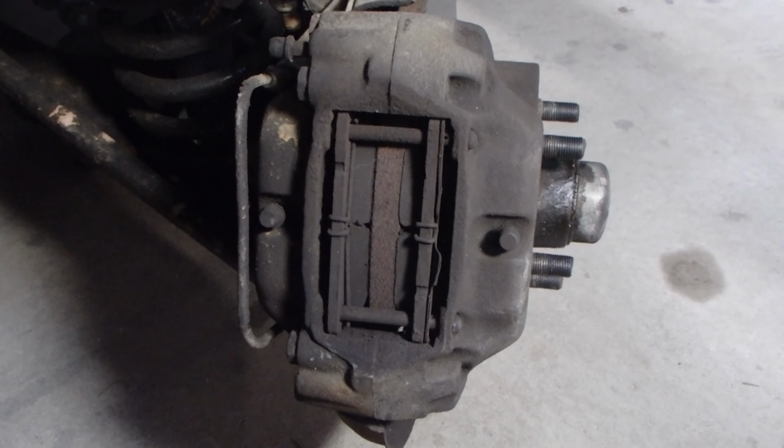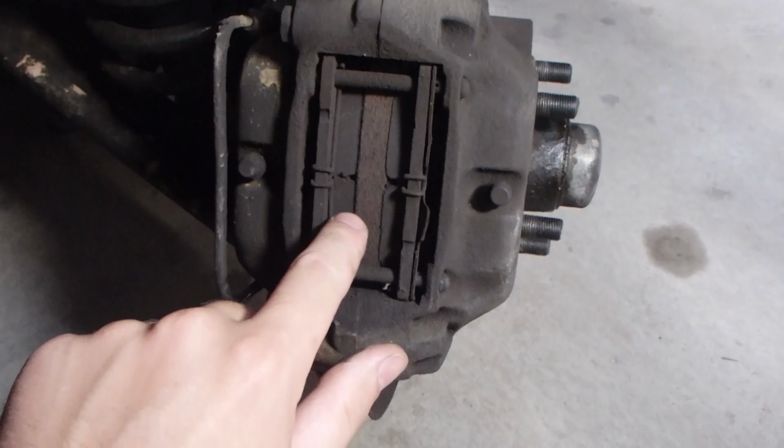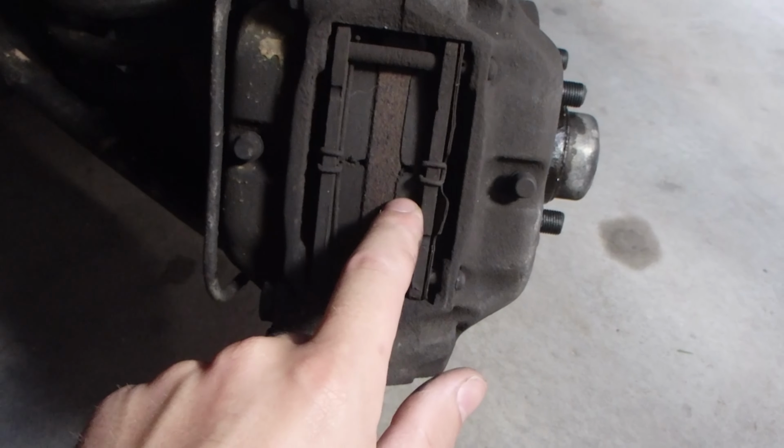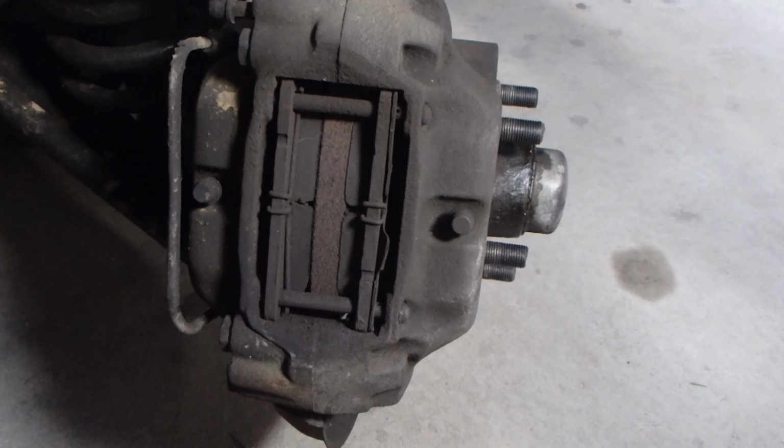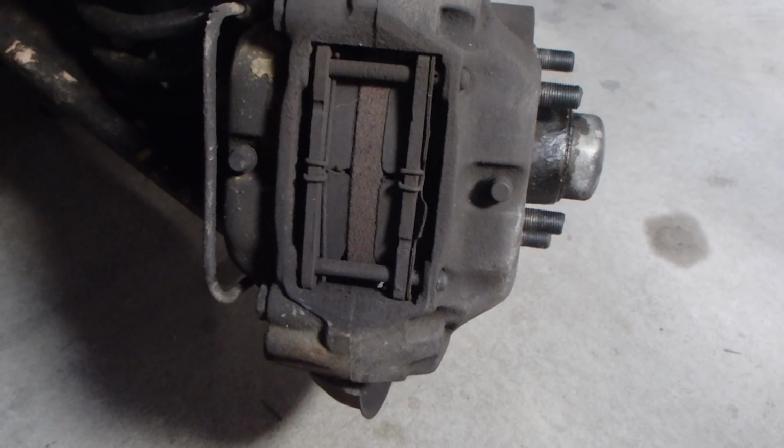So whenever you've got your wheels off, it's always a good time to be checking out your brake wear and that sort of thing. You can see there's stacks of life still on these brake pads, both of those, and I just measured the rotor up and that's measuring fine as well. It's sitting at about 60% life, so no reason to be changing those.